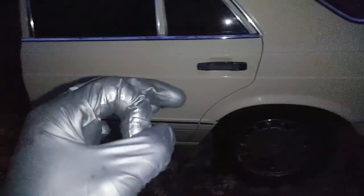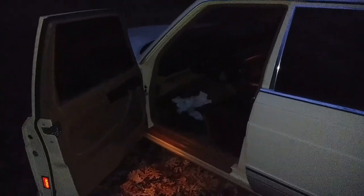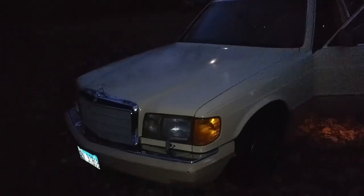It was a long crank because, well, the fuel pump was probably still okay. It's those things, there's two check valves next to each fuel pump, and they actually go out, and you replace them, and that's it. The problem is fixed. But I just decided to buy that fuel pump, and that's okay. You saw that the fuel pump was original. Anyways, the most important thing for me right now is this. I'm really happy this is running, it starts right away, and you don't have to worry about turning the key off to on. So yeah, it's pretty awesome.